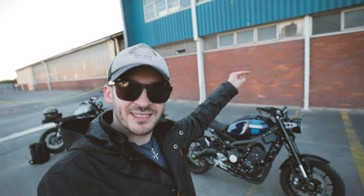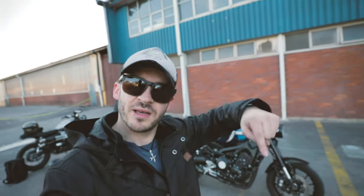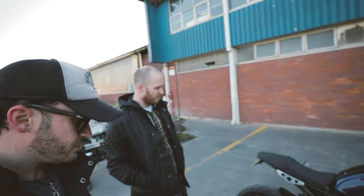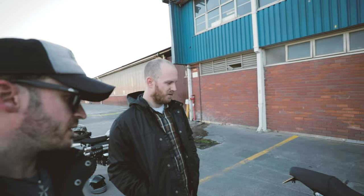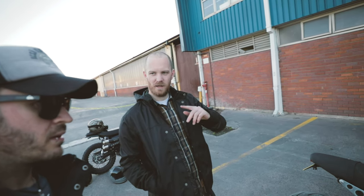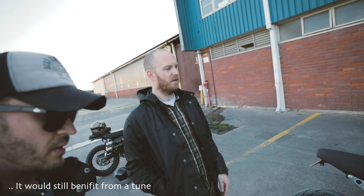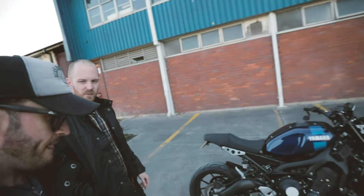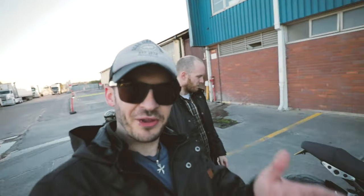So that's the sound of the 70s Conic on the XSR 900 — let us know what you think in the comments below. If you're looking at purchasing this, do it, because it sounds awesome. A little playing around with the air-fuel modifier — what are you on with that now? Just above four, between four and five on the dial. It goes zero to ten, with zero being stock, and the further up you go the more it's adjusting your air temp sensors to dial in the air-fuel ratio. I think I'm in a sweet spot now. Took it out and gave it a squirt and it just got on the back wheel — power is nice, power is good.